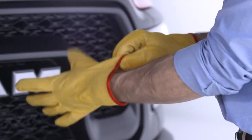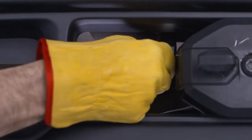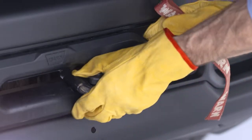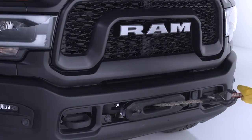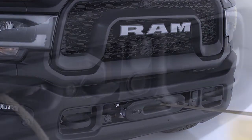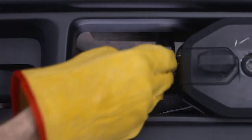Put on a pair of leather gloves and disengage the clutch. Free the winch hook from the loop on the Hawse Fairlead, attach the hook strap, and use it to pull the rope to a suitable anchor point. Connect the remote to the control box, located on the front bumper, and engage the clutch.